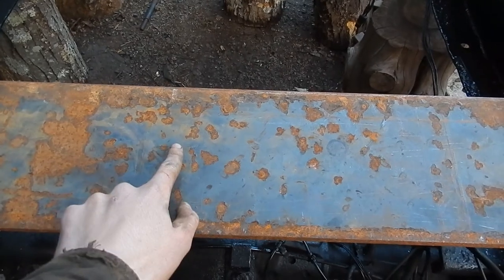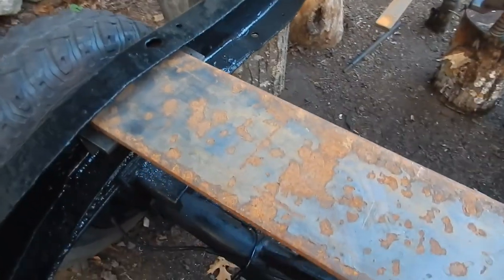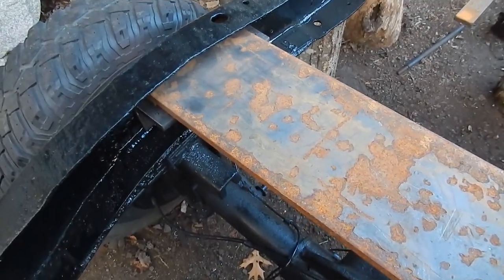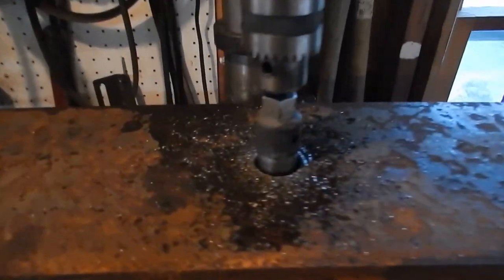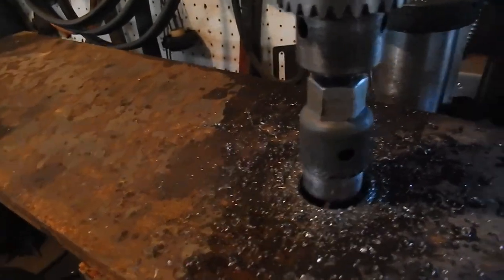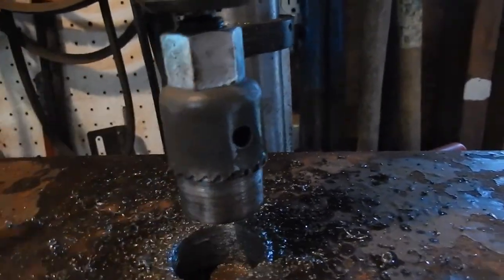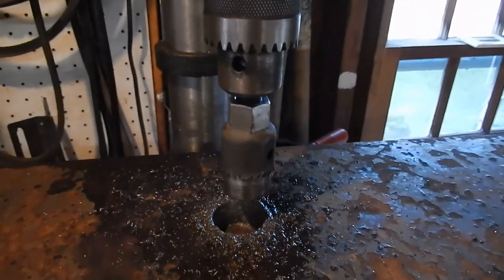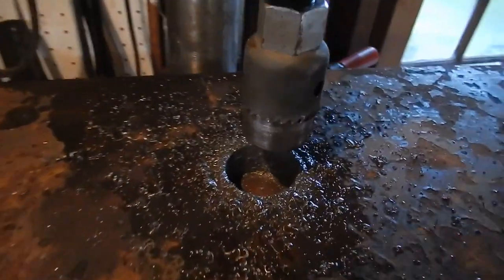So next I'm going to drill holes in this piece — the center hole for the hitch ball, and three holes on each side, all half-inch holes — then mock it up and mark where the holes will go on the angle irons. I got the holes drilled on the plate. For those wondering how to drill that big hole in the middle, a standard hole saw works just fine. I just broke through — it's still pretty hot — using a Walmart hole saw set I bought, four saws for $8.88. It took a little doing but worked just fine.